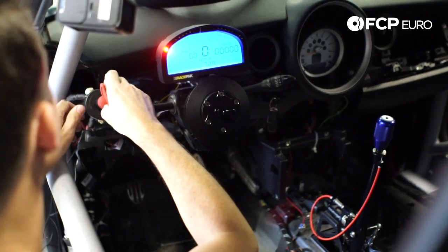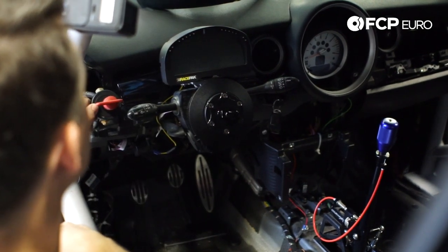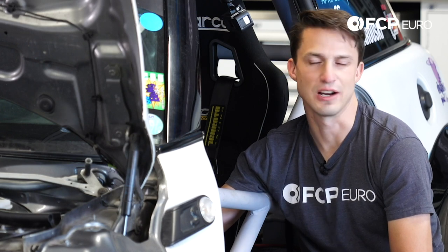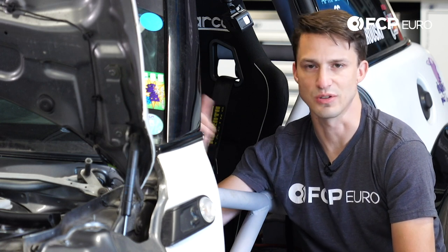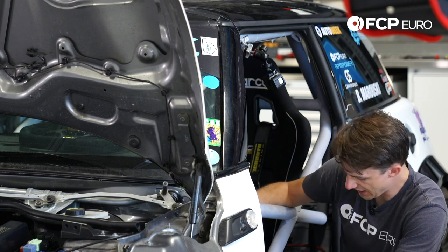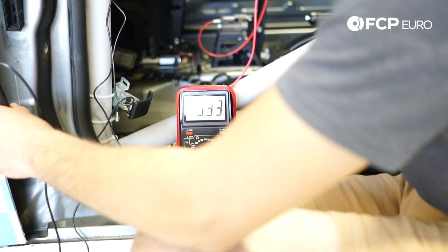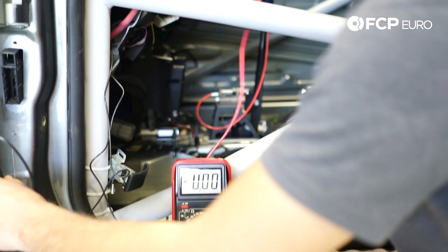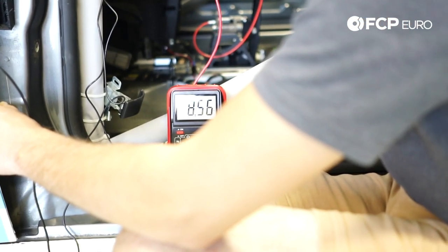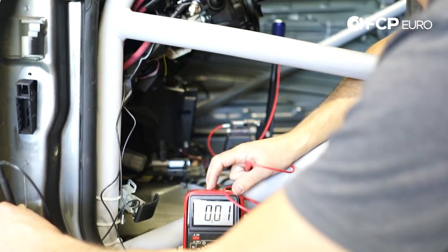When we turn the switch off with the engine running, the engine won't shut down — that is due to the alternator still making electricity that's going to keep the engine running. So what we need to do is use the other ports on the switch to actually have the ECU shut down and make sure the engine shuts down when the kill switch is turned. Here we have a voltmeter going to the hot side of the switch — the number one side — and you can see I have 11.9, basically 12 volts. Go to the switch side and I have 0.29, so basically no voltage on the other side of the switch. If I turn the switch to on, now you can see that we're getting voltage on the other side of the switch as well.